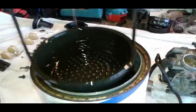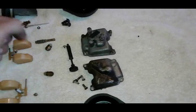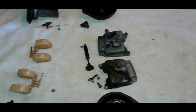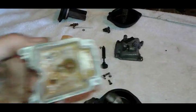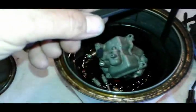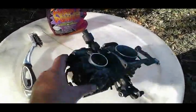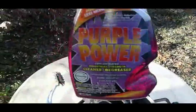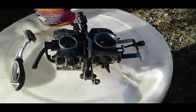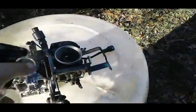It comes in a handy little tray, so all you do is take your parts and dump them in there. I'm going to put in all my jets, the seats, the two float needles - it won't hurt the rubber - and I'm going to put the float balls in there; look how nasty they are. While all my internal parts are soaking and cleaning in the solution, I'm going to give this dirty body a bath outside using purple power cleaner with a little brush. Brush it on and rinse with water, then blow it with compressed air to get all the water out.